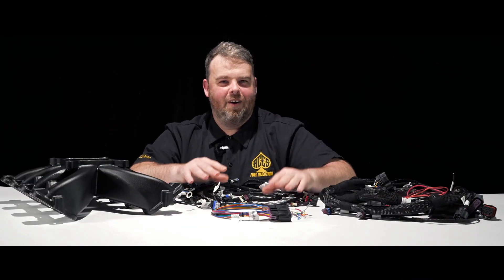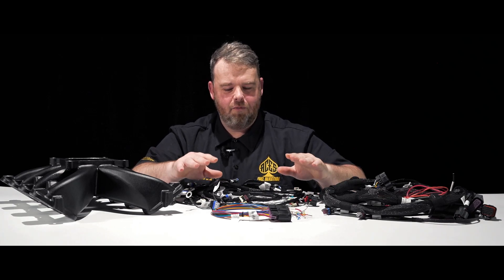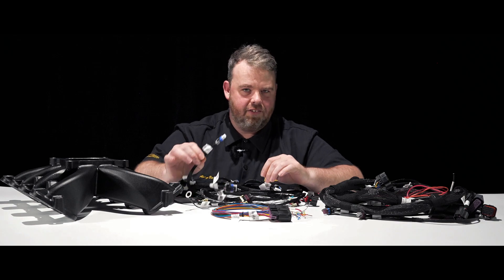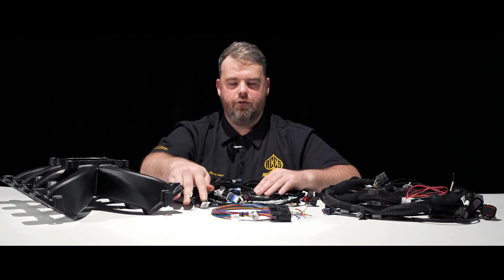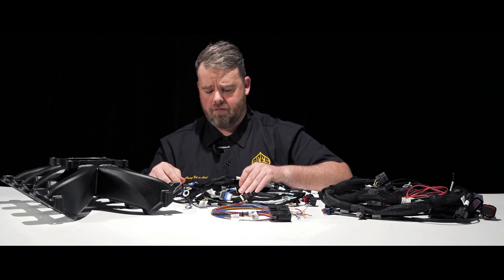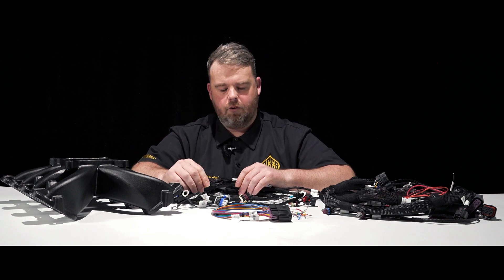Welcome to the wiring harness section of our Jackpot TBI today. If you're familiar with the jackpot already, we have a couple coil sub-harnesses. They plug into an LS3-style small connector coil. You've got to make sure those are grounded in the back of the cylinder heads — it'll give you a headache if you don't, or at least a no-start or a weird start. We have a standard-issue 4L60, 4L80 trans-control harness.